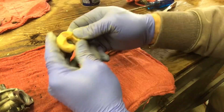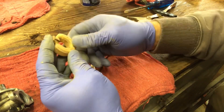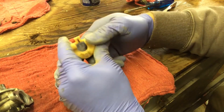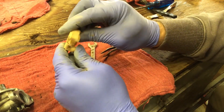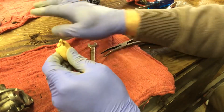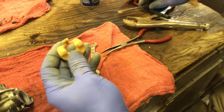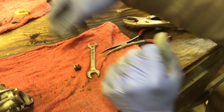I think that's as good as it gets - that's as clean as I can possibly get it without damaging the float. I really don't see any sections where big chunks are going to get stuck in the jet. You want to make sure you don't have anything in the carburetor bowl that could possibly break off and get stuck in the jet.